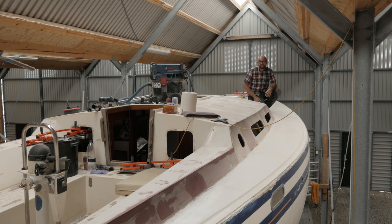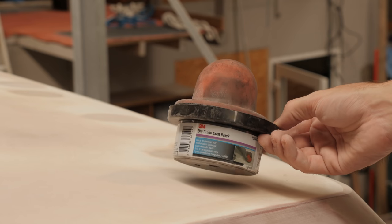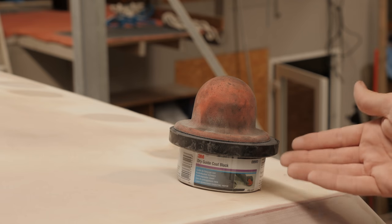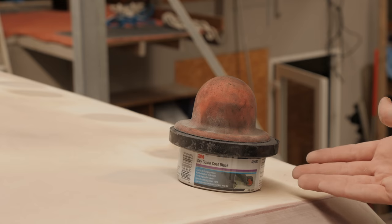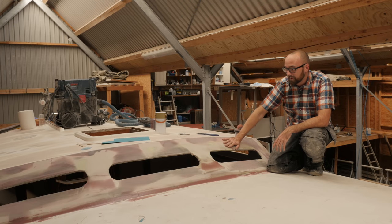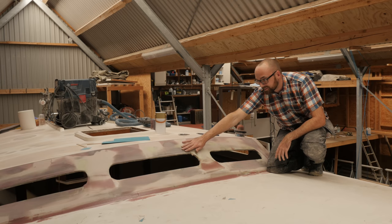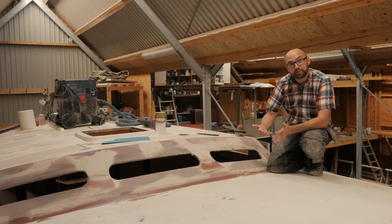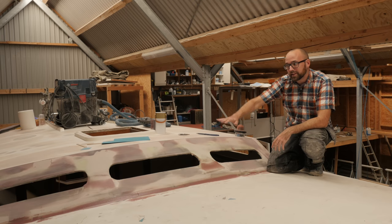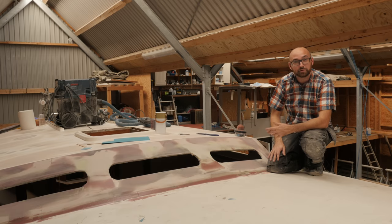But there are a few tools that can help out. One of those tools is a guide coat — whether it be in the form of dry guide coat like the stuff I've got here, a bit of spray paint, or maybe just a primer. A guide coat will help you reveal any low spots and pinholes. I've already gone ahead and applied guide coat to the forward edge of the cabin tub a couple of times and added more fairing compound as needed. The dark areas you can see here is where a bit of that guide coat got mixed with the fairing compound, so that shouldn't really be a low spot, but once I get the primer on here I can sand the first coat and see if we still have any low spots.